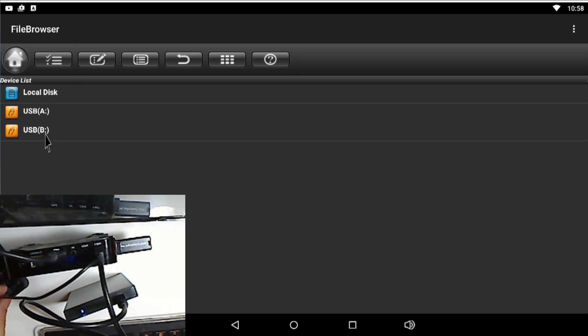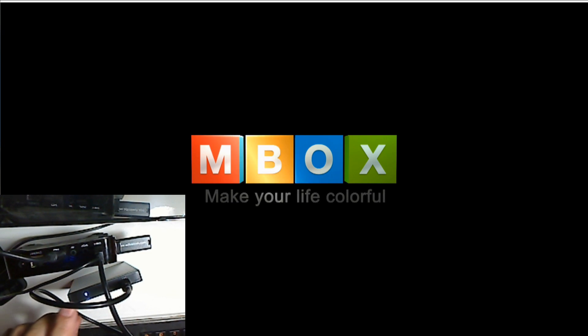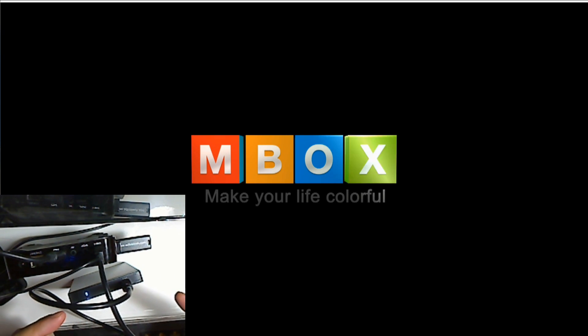If I remove that power, everything should go off. I can also just power the drive through the hub separately. So to summarize: if you're going to use an external power source and an external hard drive, keep in mind that if the drive is on, your box will be on too. For 3.5-inch drive cases, there's usually a power switch, so you can turn the drive off independently.